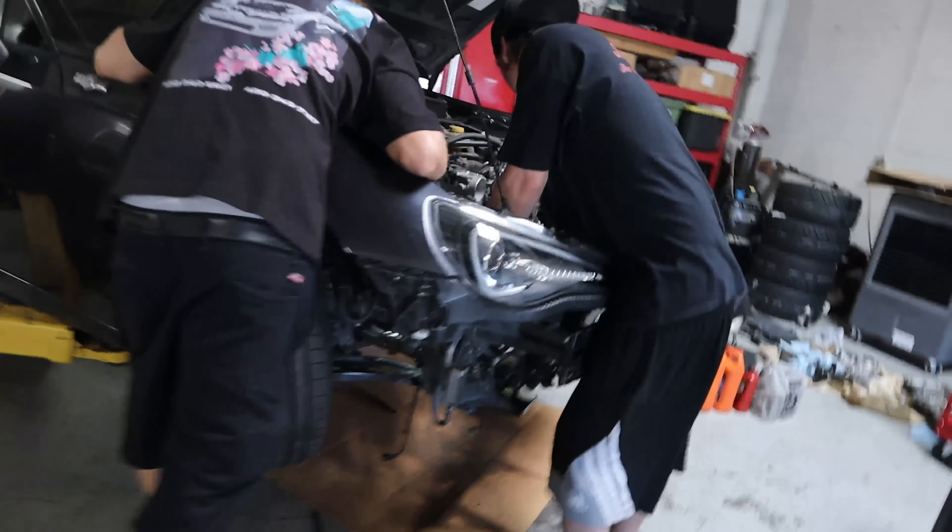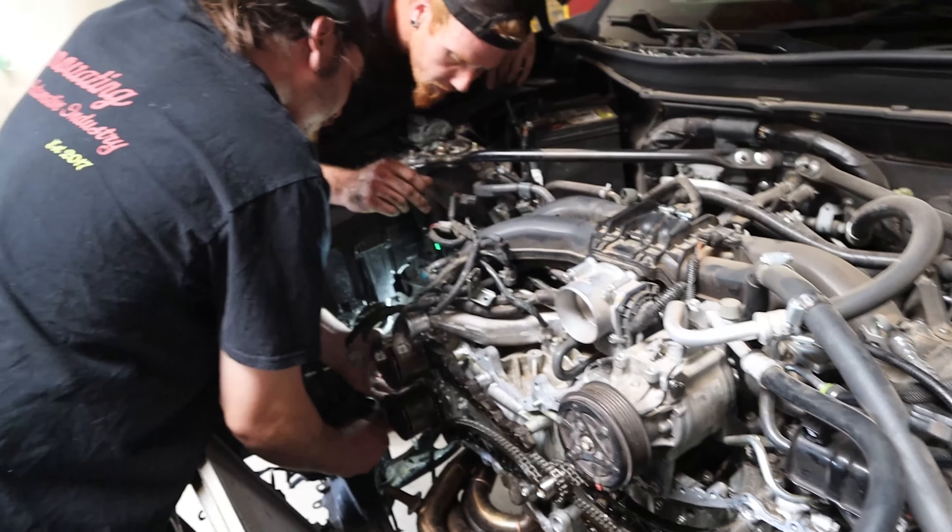Back up — next day. Already finished up the overpipe. Turned out pretty well. The fixture I'm like eight and a half out of ten happy with. The only issue was the end flange was slightly warped — I don't know if that was from welding in a certain direction, applying too much heat, or if the fixture was slightly off. Right now we've got the old gasket material cleaned off and we're working on getting the new cam cap on and getting cleaned up to reassemble. Still waiting on the valve cover gasket set.